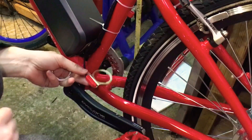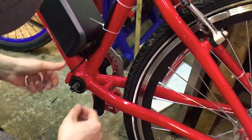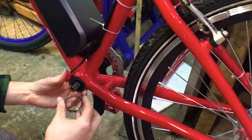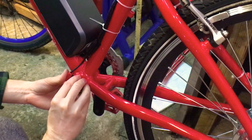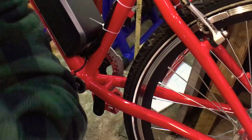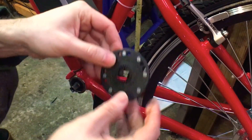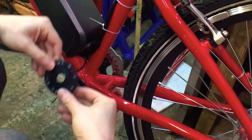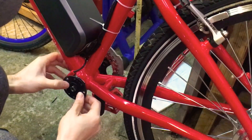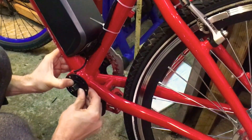To put the cadence sensor on — or the pedal assist sensor — the actual sensor here is going to go on here. This is an old bottom bracket locking ring; you can just put that on there. It's a shame the kits don't actually come with these. Once you've got this on, you then need to put the magnet disc on. It's got arrows on there — the way you pedal, the arrow should point — and then that just pushes over, just like that.